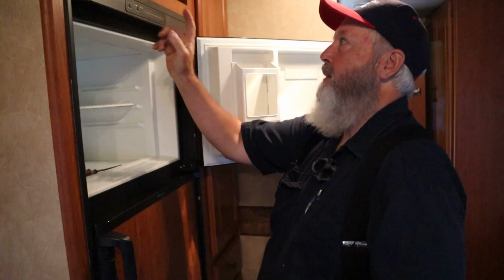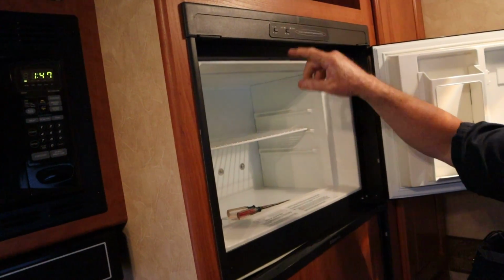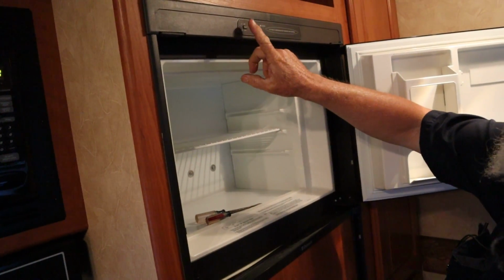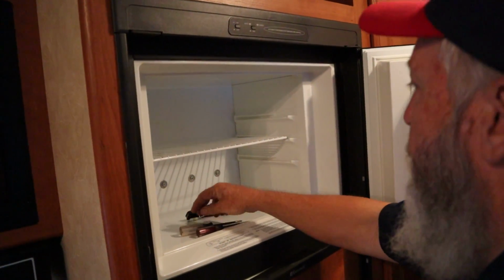So I think right now I'm going to go see if I have an eyebrow board for that refrigerator. We'll go ahead and switch it out, and then we'll answer his questions about the water system. We'll make sure we've got water in the water heater. So we're going to just carry on. This eyebrow board appears to be working right now, but see, I just touched it and it went off, so that switch is really iffy. Can you see that? So let's get this thing out of here.